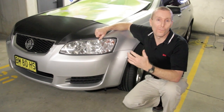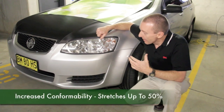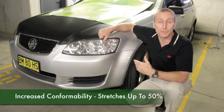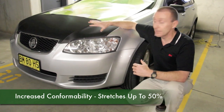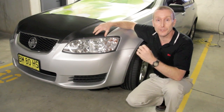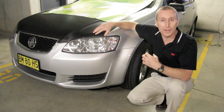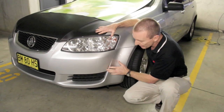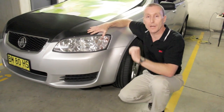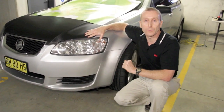One of the big benefits for the 480CV3 is its conformability. Unlike most cast vinyls which will only allow you to stretch them up to a maximum of 30 percent, the Envision 480CV will actually stretch up to 50 percent — the same level of stretch our deep recess film IJ380CV3 will. That means it's much better able to stay down in those deep recessed areas on vehicles, such as front or rear bumpers of cars or the deep window recess channels on vans.